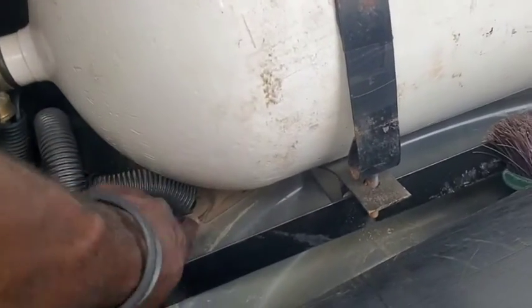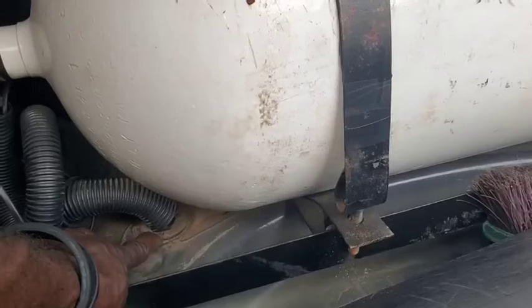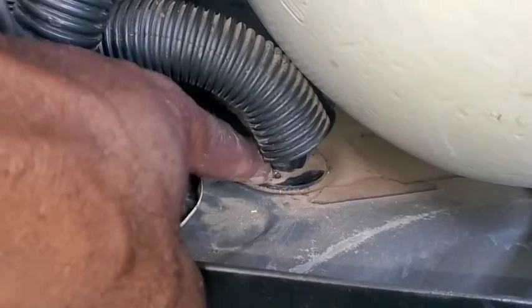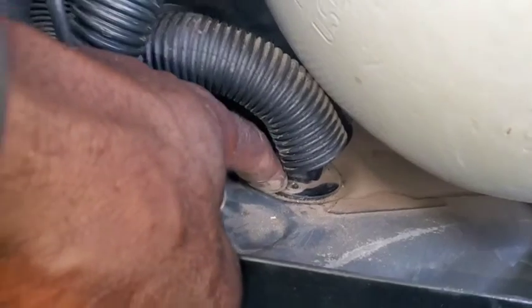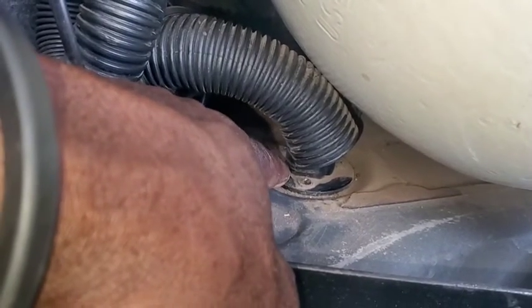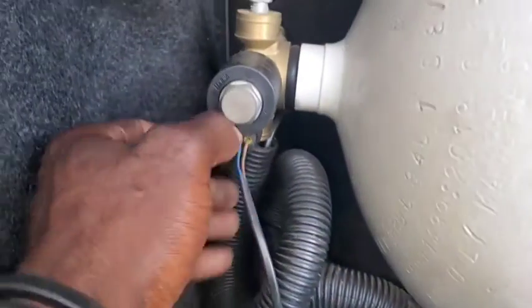The only thing coming through here requires you to perforate this side, and there is a fitting that comes with the package of the CNG conversion kit which you need to bolt in here after perforating. Also make sure that when you're doing the piping, don't leave the pipe dangling.